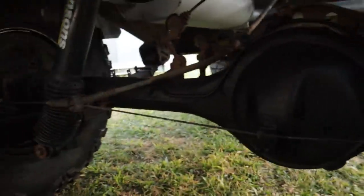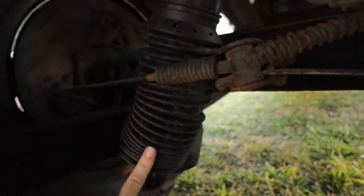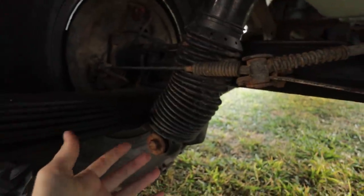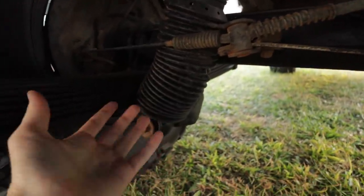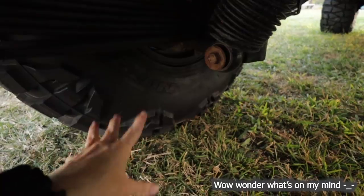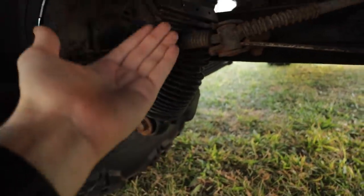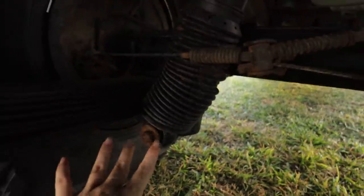If you guys follow me on Instagram, you would know that I've under body painted most of this, which is why it looks heaps better than what it did in the video. Shocks are holding up great. A lot of people were asking, am I going to keep these on? Because they tend to keep a lot of dirt and water in there. But if I just have to clean them out every now and then, I'd rather do that, because the shaft is just so close to the tire, I don't want rocks throwing up, damaging that shaft and destroying the seal. All the rocks end up at the bottom, and there are drain holes in it, so I just pour water in there until I see the water come out clear. But yeah, the underspray underneath makes everything look a lot better.